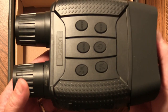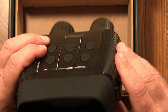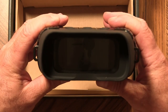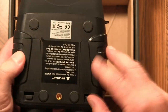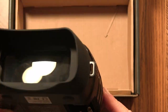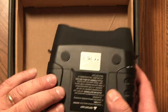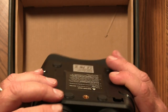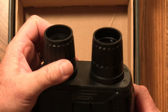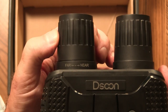Taking a closer look at the device itself: we have different menu and power buttons on top, nice grips on the side, and strap attachment points on either side. Here is your viewing screen, which is what you'll be viewing the picture through. On the bottom, there's a quarter-20 mount on both sides. It looks like it takes three AA batteries per side. On the front, you have the IR illuminator and the lens that picks up what you'll see on the screen. There's also a focus adjustment for near and far.